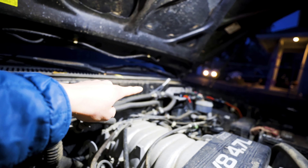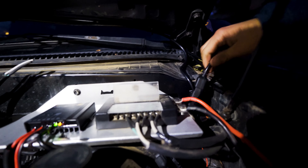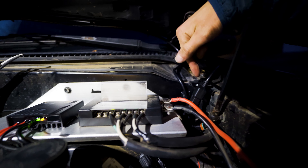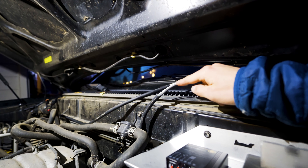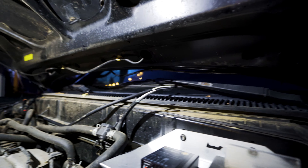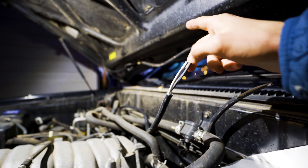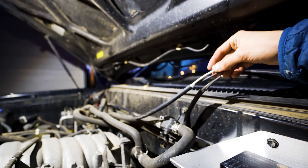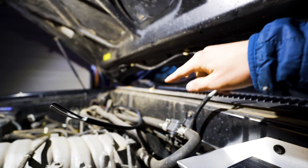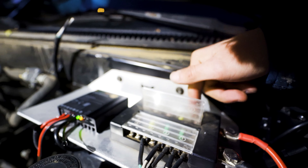This wire runs all the way over closer to the fuse tray. On the other side, same thing — we have these strands from the ditch lights coming down, connected to some of that three-strand wire that runs underneath the fuse box and comes up right here. So right now we have one positive and one ground for the driver's side ditch lights, and one positive and one ground for the passenger side ditch lights. The last step is to join the positives together and join the grounds together — then we run it to our fuse box and connect to the positive and ground on our fuse box switch.